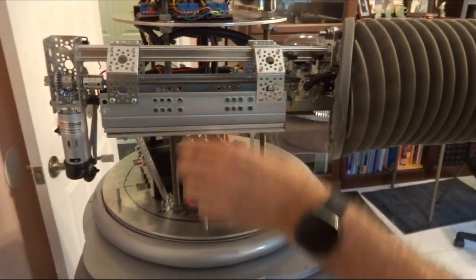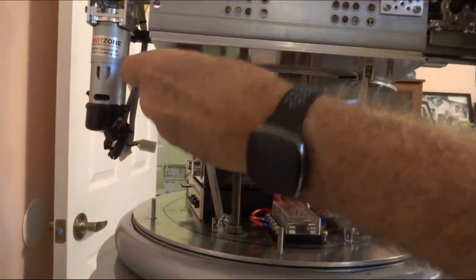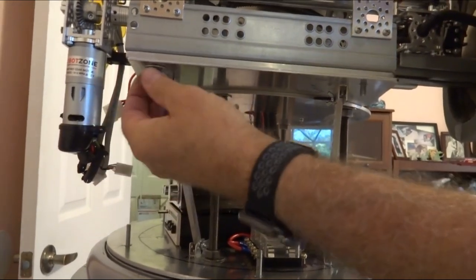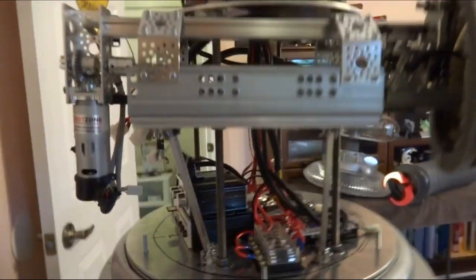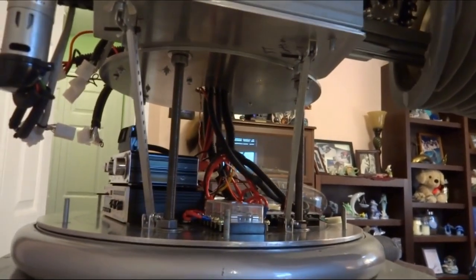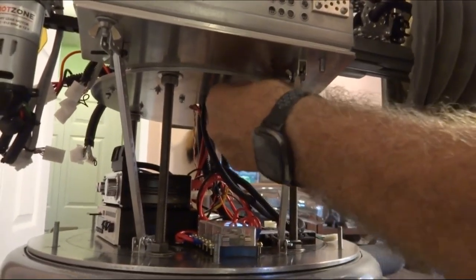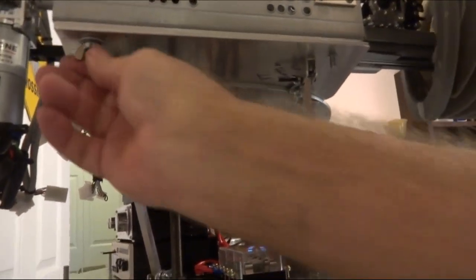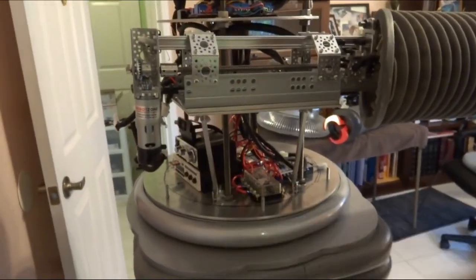Once that's dropped into those holes, you just take a washer and a quarter-inch wing nut and spin that right on. Do the back one first because that'll support it and won't tip. There's another one in the back here and one here — just reach up through the arm vent. Put another one here and another one back here. You're going to have to be working through this vent hole, so there's not a lot of room. Just make these finger tight — give them a good cranking with your fingers as hard as you can get them.